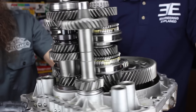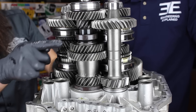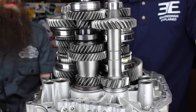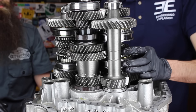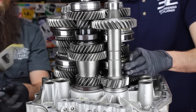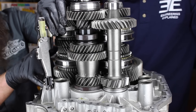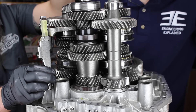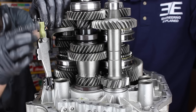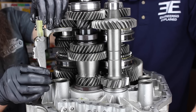One really cool thing is there are these wheels all throughout these gear sets. This actually lets the mechatronic unit know exactly where each position is and what's rotating at what speed. This is the selector that's used to select each gear. There are little pistons inside the case — one will move it up, and on the corresponding side on top it'll move it down. This piece right here is actually a magnetic position sensor, so the mechatronic unit knows exactly where each selector is throughout the process.